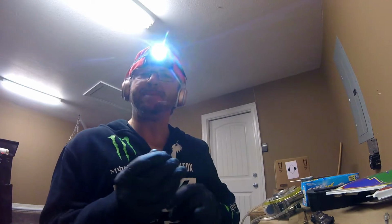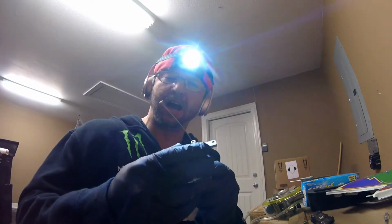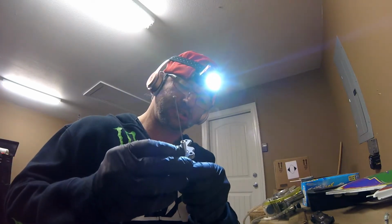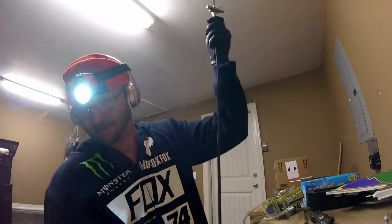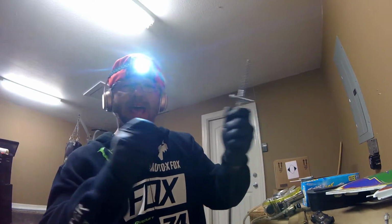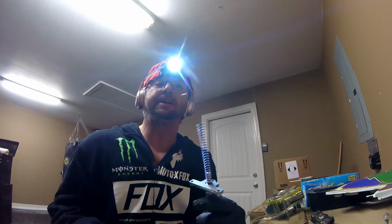So look here. For those of you that really need some instruction, stick your cable through the hole. Put some threads on that. Just like that. You understand what I'm telling you? Put the spring over the cable. Give all the slack you can. Put no slack on this end. On the throttle end, don't put any slack. It's far up in there. See, look how easy that was.